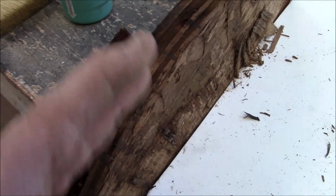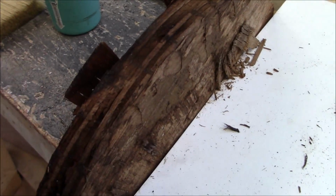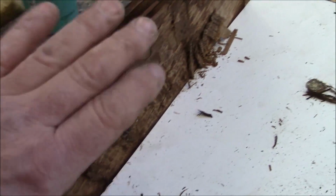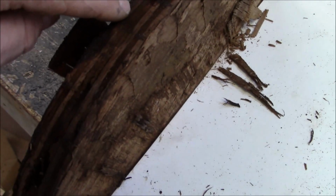You can get thinner plywood, all different plywoods, and when you look at it, it'll say, in this case, it would probably say 8 ply on the label, or another sheet may say 4 ply, or 3 ply, and so forth. That's what you would want to look for, and that determines how much strength is going to be in there, the rating on the sheathing. But nonetheless, even though this is a pretty good, substantially thick stock, you still can't put the screws in there. They're not going to hold right. So we're going to do these with solid stock on here.